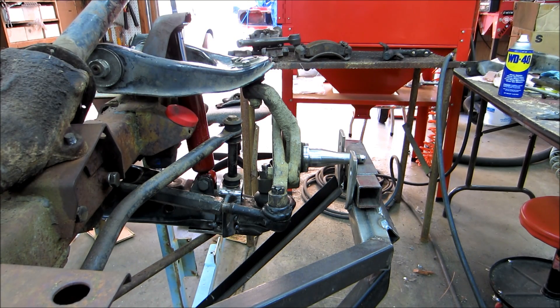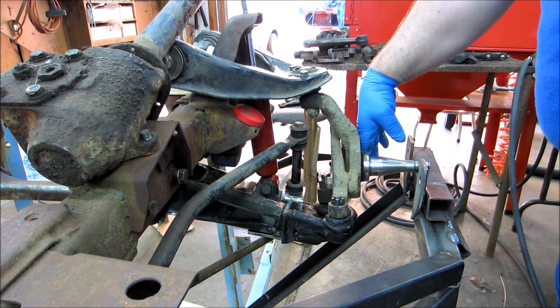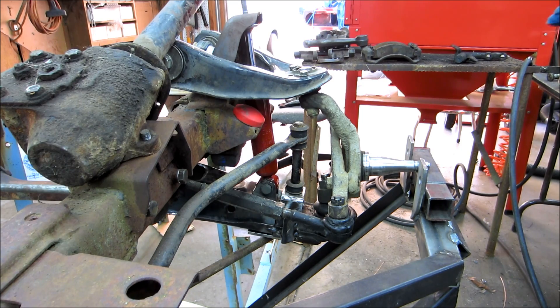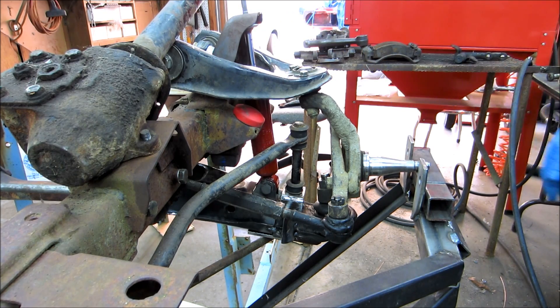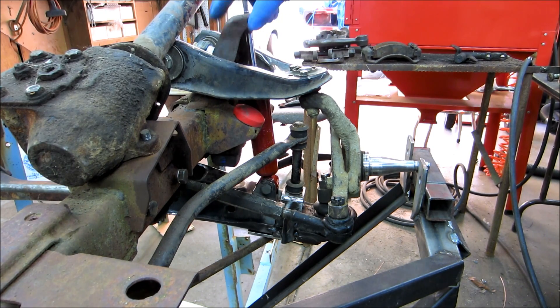We're back. I'll take it off the stand and show from a different angle in just a minute. We are now at roughly 0.9 — almost a degree of negative camber. My understanding is you really wouldn't want much more than that or you're going to start getting too much tire wear. So that means you're going to be somewhere around a half a degree at ride height. The fact that we're in just a little bit more now means I can check clearances and know we could go at least to zero camber and a half degree in. It was kind of a pain — I had to put longer bolts in the top. I think it's going to cause some other issues as well; in fact I think I can take the shock out that way so I don't have to keep fighting it.